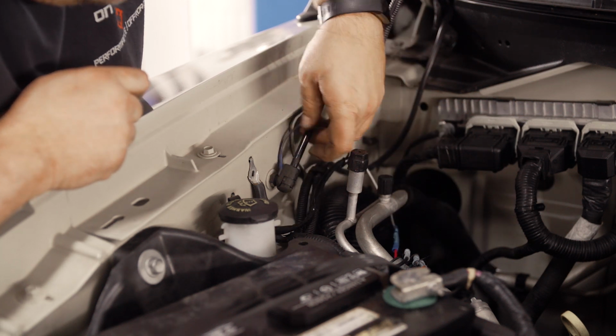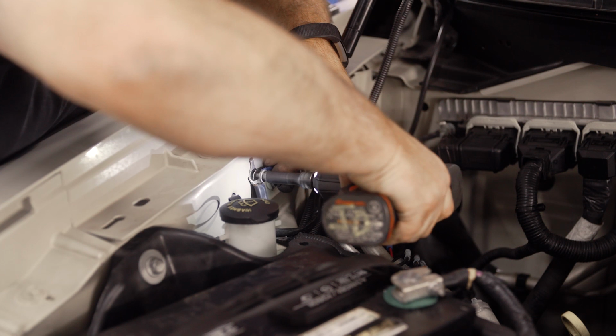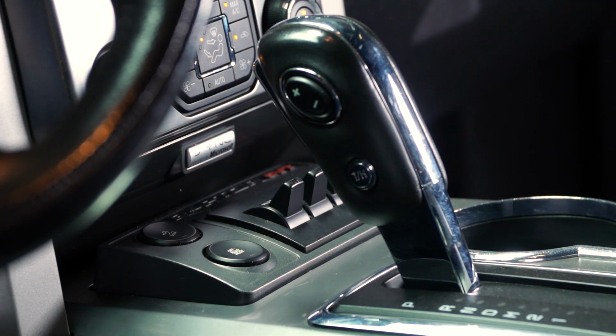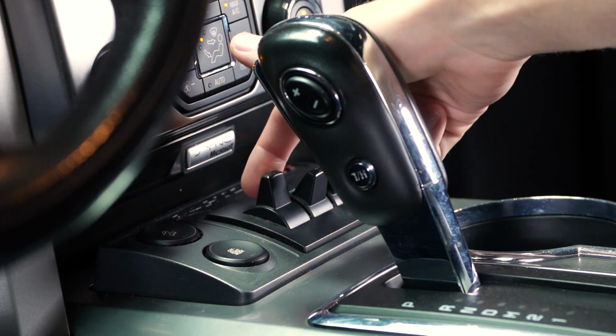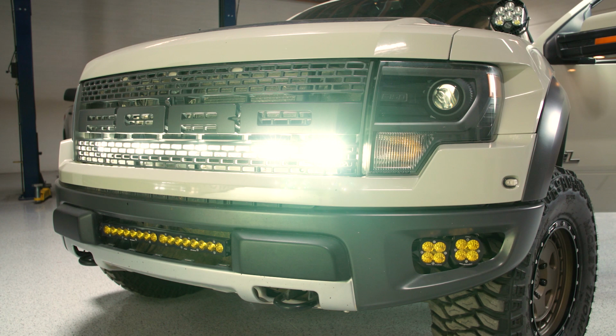Review the last page of your included instruction manual to determine which wire colors correlate to the upfitter switch you want to use. Once you've spliced your wires together, test to ensure that everything works properly, and that'll complete the install on this OnX6 light bar. As always, thanks for watching.